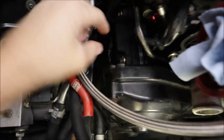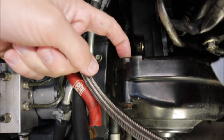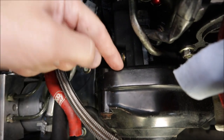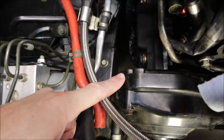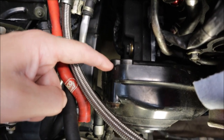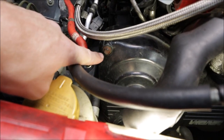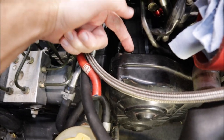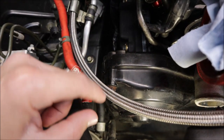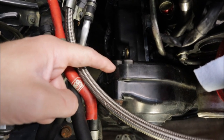You could put a punch through the back — there is a hole right behind it. There's not much clearance but there is a hole through here. I actually sprayed some penetrating oil in there and let it sit overnight. Next option would be some heat — if you heat it up enough it might grab the bolt again, though that seems unlikely. Other options include drilling holes in there, or cutting the bolt off — a lot of people just grind or cut the head of the bolt off. I'd like to save these front covers because they are in pretty decent shape. The damage occurs at the back cover, which will have to be replaced. I don't want to cut the head off unless I absolutely have to. I might even take a chisel to it to break off some pieces and get to that bolt.